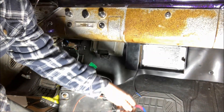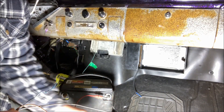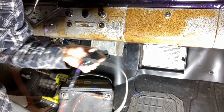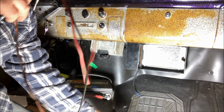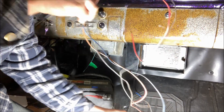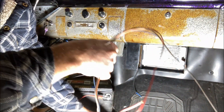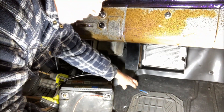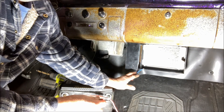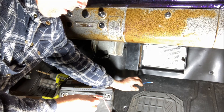We're inside the truck and I'll wire this up with jumper leads just to test it. We're going to have five wires. We got three wires coming out of the switch: red, blue, and black. I've extended those wires with the same color long wires, just because I'm going to have to mount this switch up in the dash. And then we have two wires off of the fan motor — positive and negative. On this one, the blue wire is the positive and the black wire is the negative.